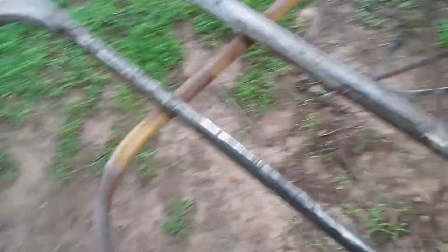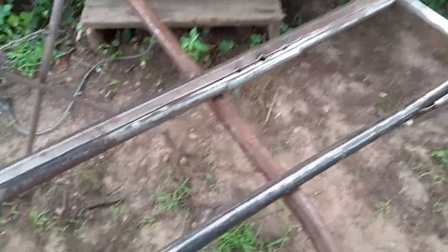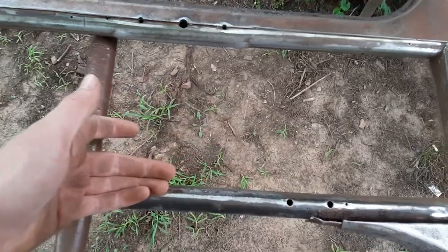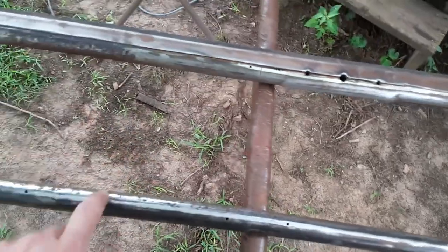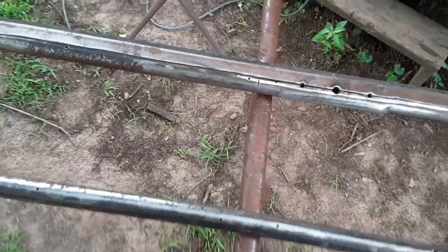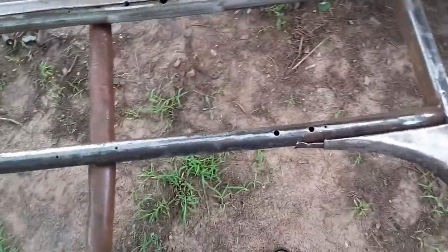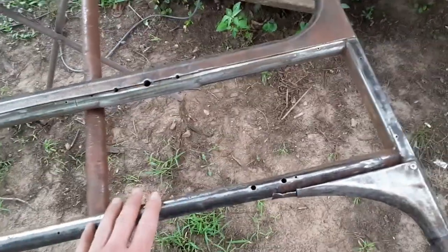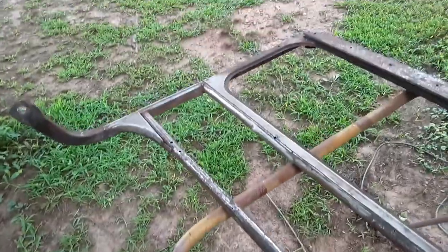I've been working on this thing a little more and I pretty much got it sanded — got all the chunky rust that I can get off all the way around. I've just been sanding right here because I'm planning on putting that patch in and welding it all up, then I'll finish sanding everything else. I'm going to pour POR-15 in between the new and the old metal, seal it up good both top and bottom. I would do it now but when you go to weld it's just going to catch on fire, so I'll do that after the fact.